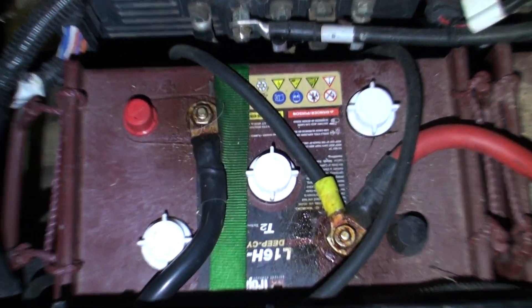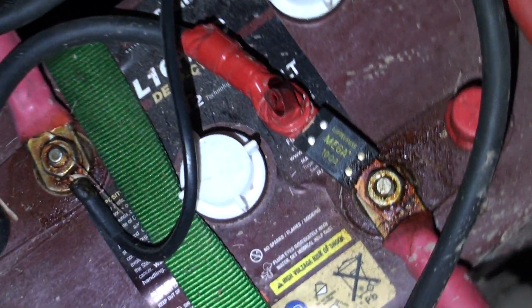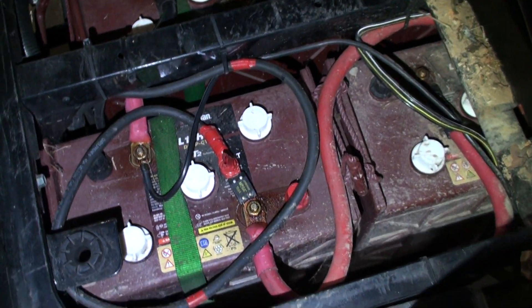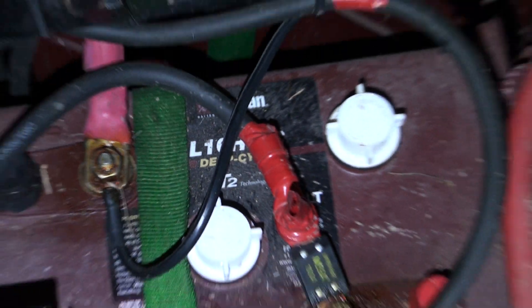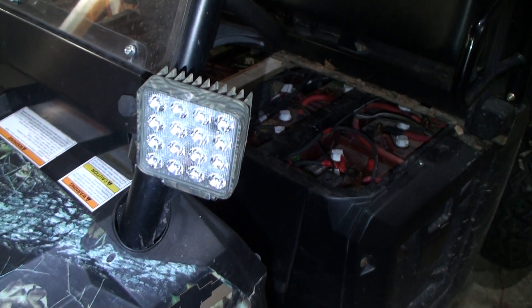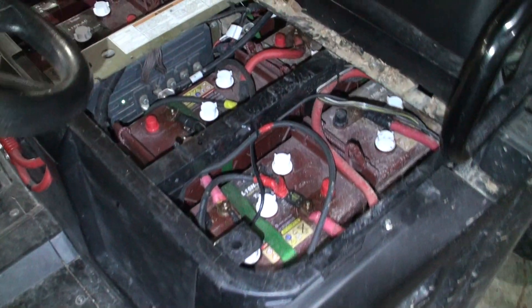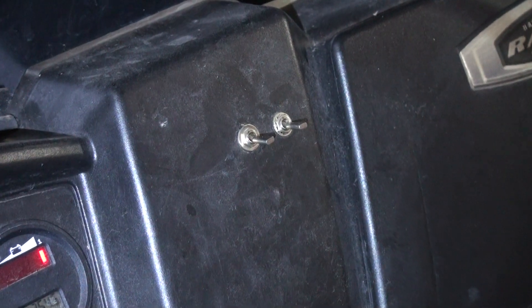The black cable here goes to the winch, so I've got two of those. The red one on this side has a breaker on it. I've also got some 12-volt wiring here — a 12-volt run — and that's what I'm powering my lights with. Those run 12 or 24 volts, which I got off eBay, 10 of them for about 20 bucks apiece. I've got those wired up to some switches on the dash, which I also bought off eBay.